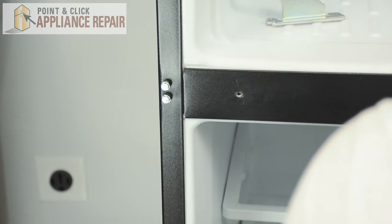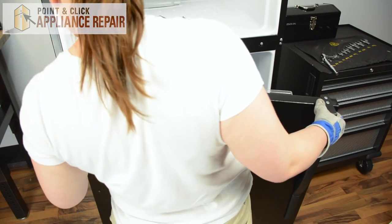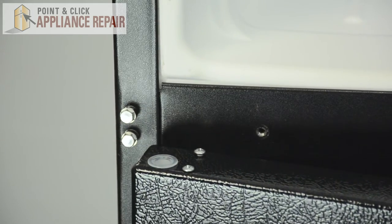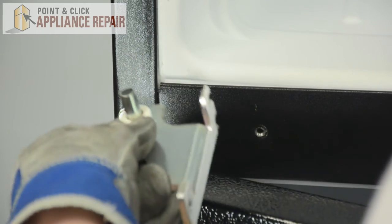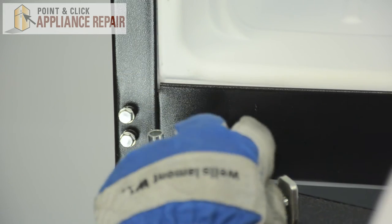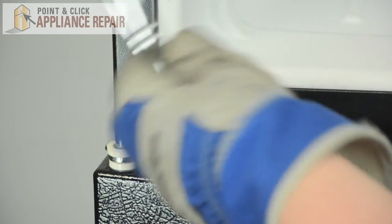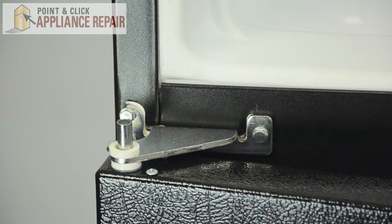And we're ready to mount the door. So we can lift up on the door and line up the hole on the bottom with the hinge. Once that sits in place, you can shut the door — bring it in to the point where it's almost closed. You can place your center hinge in the door. Make sure that both the spacers are on the hinge. Once that's in there, you can line up the hinge with the screws, make sure all the holes are lined up, and place that bolt. Then tighten down the two outer bolts with the wrench.